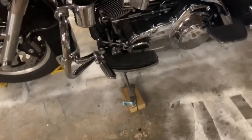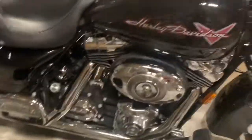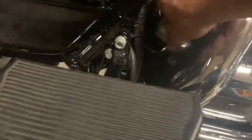For your oil change, you're going to want to take your 5/8 socket and take this plug right here out and drain it into a small pan. What I've done to help level it up is I scotched the front wheels. You don't have to do this, but I block up a 2x4 underneath my kickstand to pretty much level it up. When I want to get the last of my fluid out, I'll just assist it a little bit. Slide the pan up under here like so, and open the dipstick hole to help the fluid drain out better.